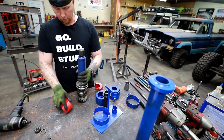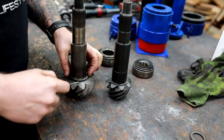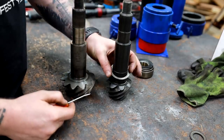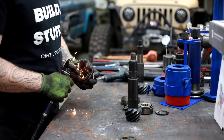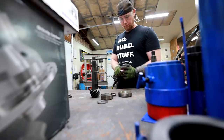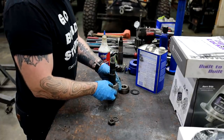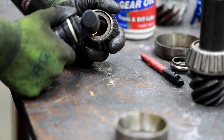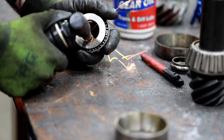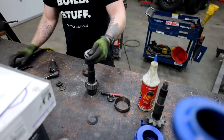The first thing I'm going to do is remove the old bearing off of the old pinion, take the shim, and drop it onto the new one. Then I'm going to take a die grinder with a carbide bit and slowly auger out the inside diameter of this bearing to give me proper clearance so I can slide the bearing on and off without a puller throughout this process.